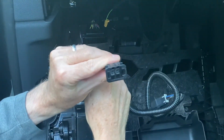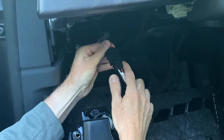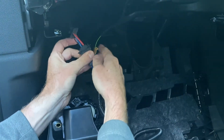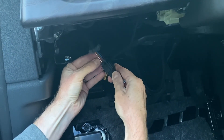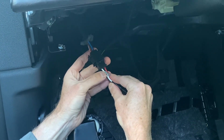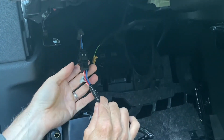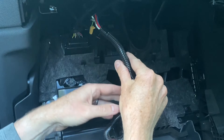This is the end we're going to plug in — the adapter basically clips right in like that and the wires are already matched up. You have red, white, black, and blue, and you'll see how those match up: red and white goes to the black, brown goes to the white, there's a very thin black and red cable that goes to the red, and blue matches with blue. Technically you could make this harness yourself but I'd rather not butcher the factory harness.